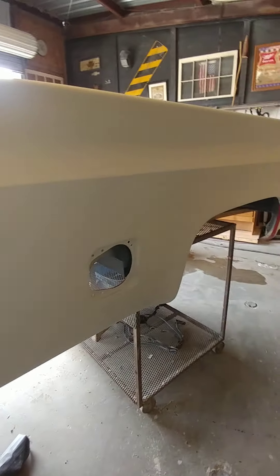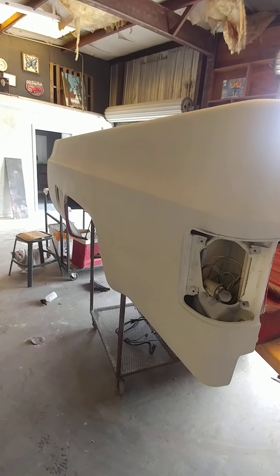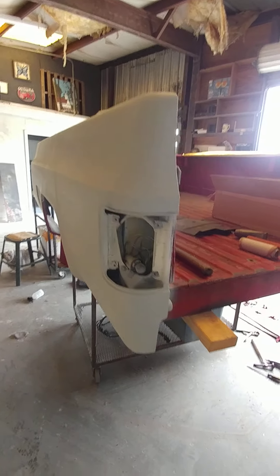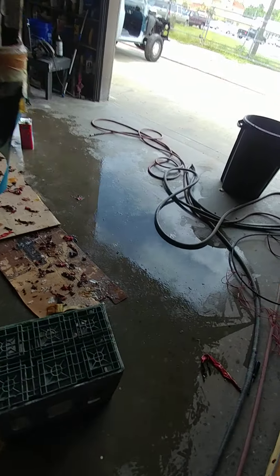The other day I stripped this down with a bondahog and did the body work and it took me an hour or so, maybe two, to strip it down. I 80-grit sanded it and got it ready. Then I had a bright idea to get some stripper.